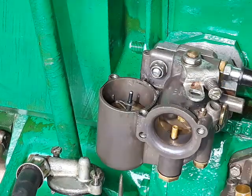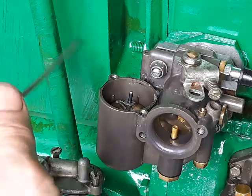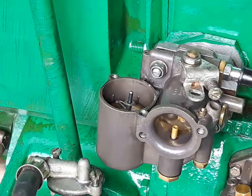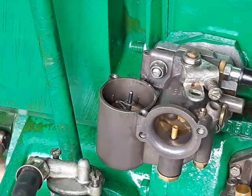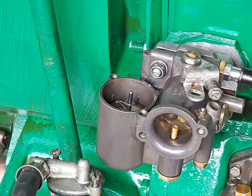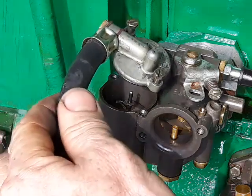If it's too low it's going to run too lean, and you'll find that the mixture tuning screw is more than one turn out. If it's too high because it's flooding, it's probably because this needle is defective and leaking and allowing too much fuel in. Having established all this — this engine is now fixed and correct — it did have a bad fuel pump membrane and gasket, which I fixed.